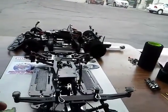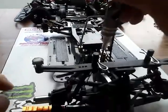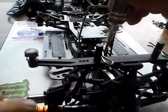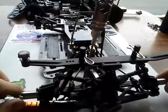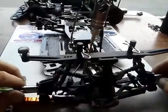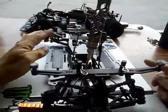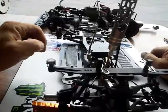That's what I do first. To set the downstop screws, right in here there's a little screw — it takes the control arm up and down. You should have front and each side, left and right, in the back the same. Same with the front: left and right the same. That makes the car handle.